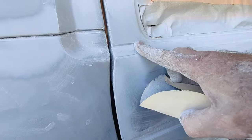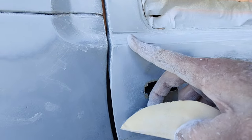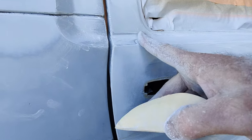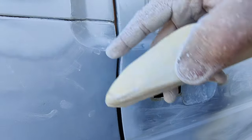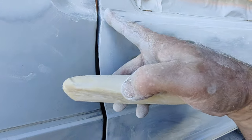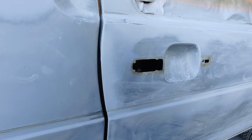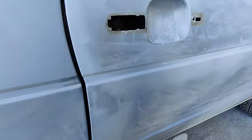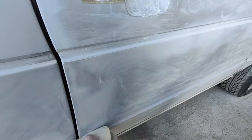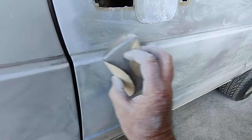So all my cut throughs, like right here, I'm just going to go ahead and spray can those with that wet on wet. I use a little wet on wet spray can, spray over that, spray over this, spray over that. And it just makes them so they don't bleed through as easy. That's all it really does. I mean, it adheres better too. So if you got metal showing, you can put that on there and it sticks to the metal.